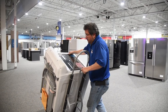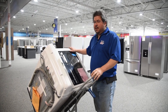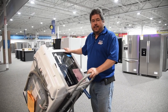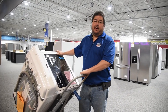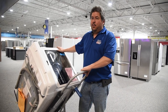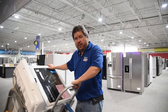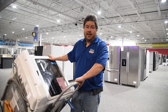One thing you have to watch out for is if this thing starts to fall off your dolly — you may not have centered it right, or you may have run into something — let it go. Do not try to grab it, because if you grab it, it weighs more than you. It is going to pull you and throw you and hurt you. Let it fall. No one's gotten fired here for damaging an appliance. You do get fired for damaging an appliance and not telling anybody. Things happen — we know this, we can live with that. So if it decides it wants to go over, let it go, because we can replace the door. It's hard to replace any part of your body that gets damaged.